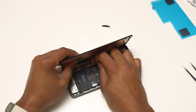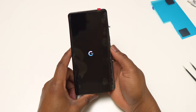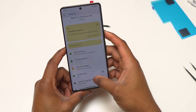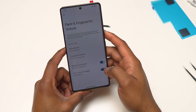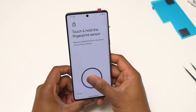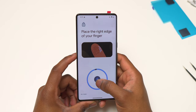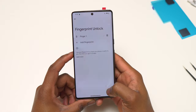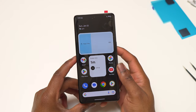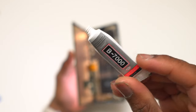I reconnected the flex cable of the new screen onto the motherboard and turned on the device — it turned on normally. I tested touch responsiveness and everything looks good. Then I tested the fingerprint sensor: the fact that we can access the fingerprint sensor settings means it is in good working condition and it is registering my fingers. During my Pixel 6 teardown when I swapped two screens, the fingerprint sensor stopped working due to compatibility issues — but since this is the same fingerprint sensor that was on this device, compatibility issues should only occur with a different fingerprint sensor.